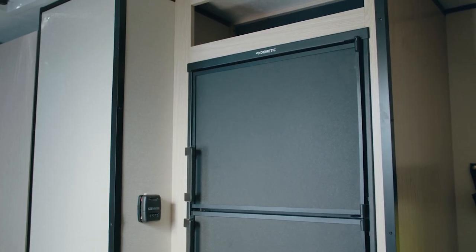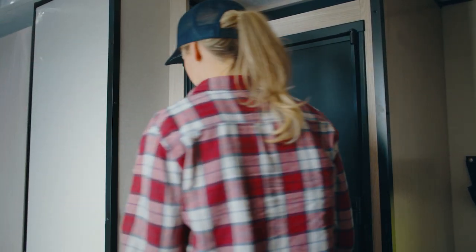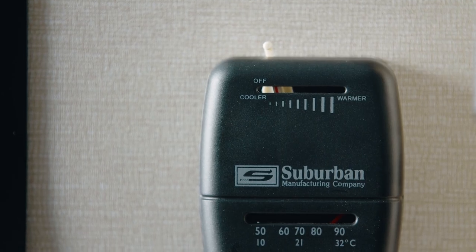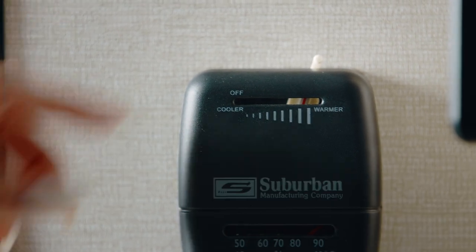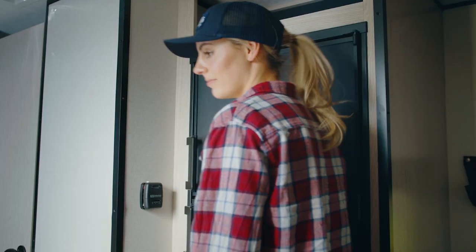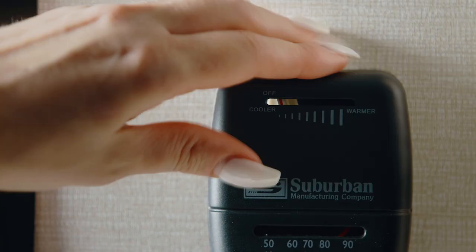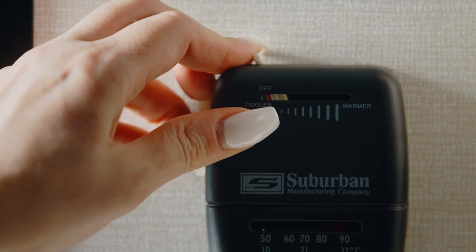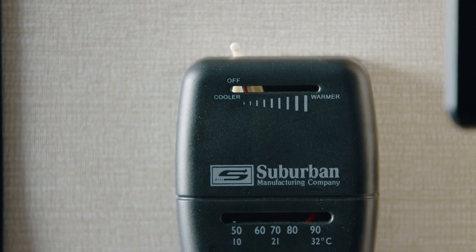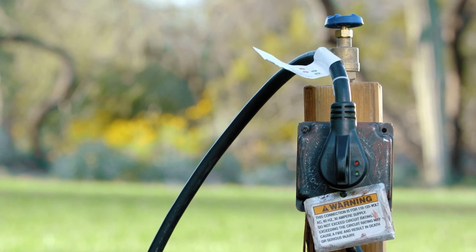The heating system is separate from the air conditioning unit. You'll find the thermostat on the wall — it controls the heating unit. This system doesn't need full power to work; it uses LP for the heat and the battery to operate the fan. To turn on the heat, move the top lever from the off position to the left. You should feel some resistance and then feel a click when it engages. Adjust the temperature to whatever feels comfortable. If you are dry camping, the fan will run at most two hours total on a full charge. We recommend making sure you have a full battery if dry camping in colder weather, or better yet, be plugged into a power outlet.